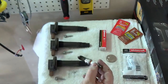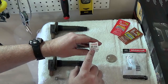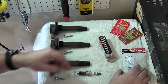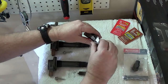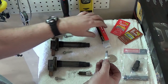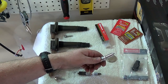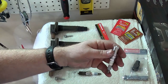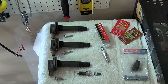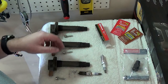The old gap was about 38 thousandths, less than I thought it'd be. The new parts Ford recommends are SP-534 - that's the Motorcraft plug - and the new boot is WR6135. Ford has taken the new gap down to 28 thousandths but gives a range of about 28 to 36 thousandths. I'm going to go with 30 thousandths on all of them. You can go all the way down to 28 thousandths - some people recommend that if you're getting into tunes.